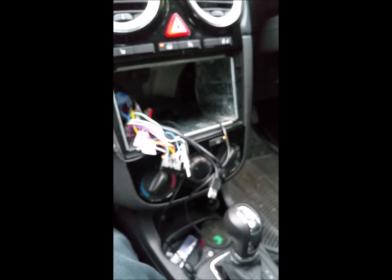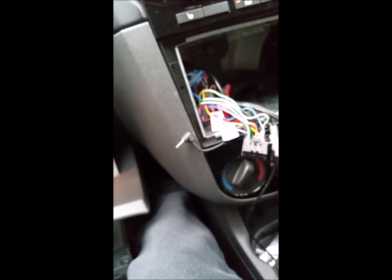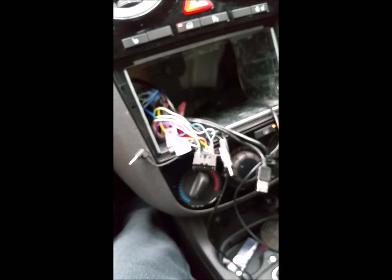For this bit, let's work on these USB cables and the auxiliary cable that I've threaded through. I basically reached in here — I won't put my phone in there because you probably won't be able to see in the lighting. But essentially that cable goes straight through there and then comes through over the top and down back into the glove box. If I pull here, you can see there's some cable moving there — that's basically how it's threaded through. It doesn't have to be massively secure but it'll do the job, and it's long enough to come through into the passenger box.